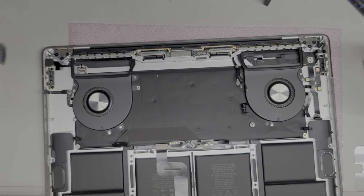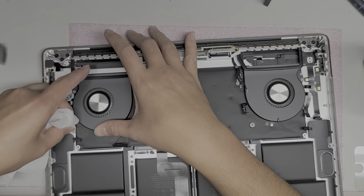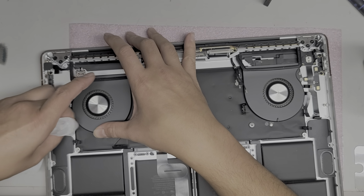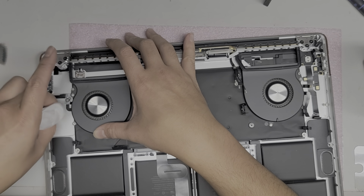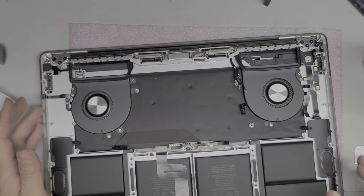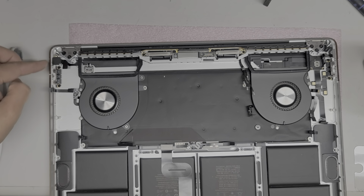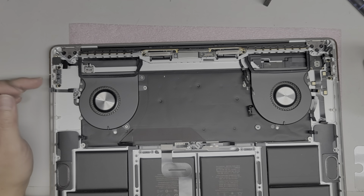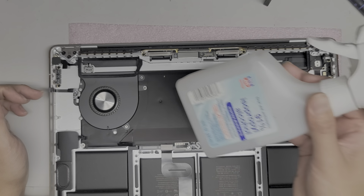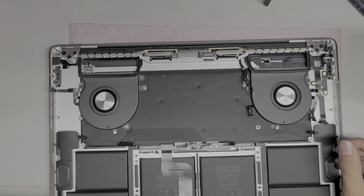Okay, I don't know where you can get replacement parts for these yet. Usually I find parts on like eBay and Amazon, but this computer might be too new to find the proper replacement parts, so I have to see if I can repair them. What I do for corrosion, I've seen that white vinegar works pretty well. You basically just brush the contacts with vinegar and then rinse it out with water and make sure it's dry. After you use the water, you can dry it and then spray it with isopropyl alcohol and then dry it again, and that should remove all the moisture.